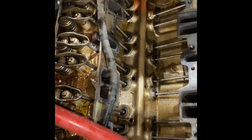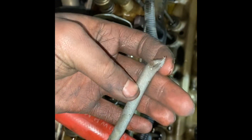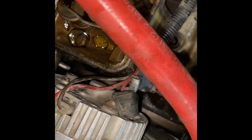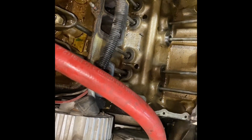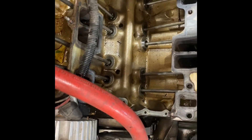In preparation for the new carburetor and intake, I have to change the way the fuel line works. The old hard line was seized into the carb so I just cut it with a pair of side cutters, then made a nice cut with a pipe cutter. Now I can stick my soft line on it, put an inline fuel filter, and it's all made up to that new Quick Fuel carb. I'll check back in when the gaskets are on and the intake is compressed down.